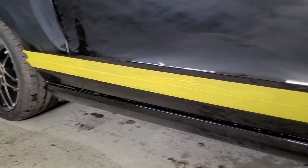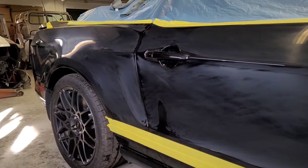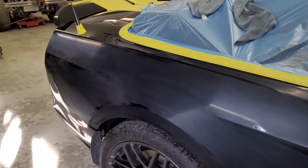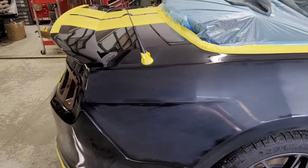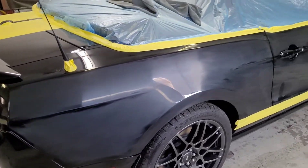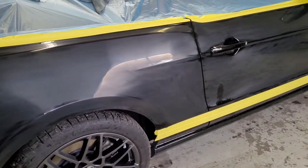Not doing certain areas — they aren't that bad, and they're also around the emblem. I won't be doing the lower doors because they are covered in a 3M film, and under the tape is the GT500 stripe. It looks a little blotchy but it'll polish up really, really nice. As you notice I didn't touch any of the edges for multiple reasons: one, they don't orange peel as bad because of the way the paint lays down, and two, they are way too risky to wet sand and polish. You do not want to burn through on a paint job like this, or on a $100,000 car like this. So we will go after it and get it polished up, and I'll show you the process.